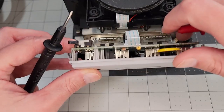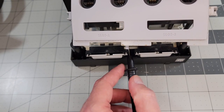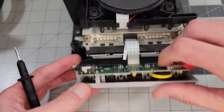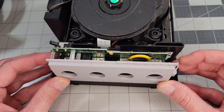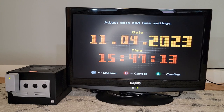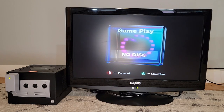So let's see what the meter says. I'm putting one probe on the positive terminal of the battery and the other on the connector land for that first pin in question. That beep means we have continuity in the circuit — that piece of paper solved the dilemma. So I trim it a bit shorter and get the plate back in place. You can hardly even tell it's there. Now I have the console loosely pieced back together, just to set the clock with the current year and leave it unplugged for a while to make sure the battery is working. All that's left is to button this up and do a final test.